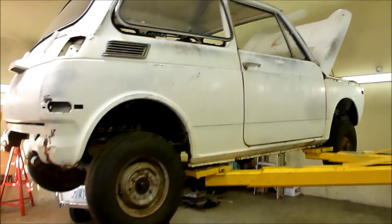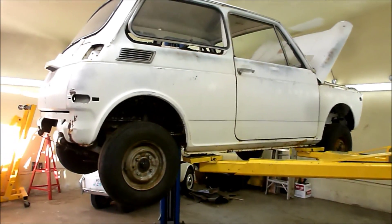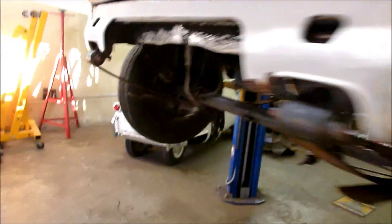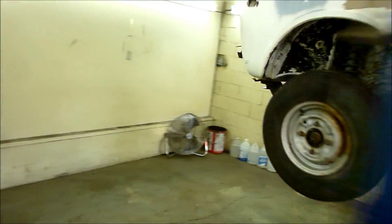It's been some time since I've done an update on my Honda 600 with a motorcycle engine. You can see we've got it up here on a rack, and I'm happy to say all the brakes are done. If you look up in there, we've rebuilt the wheel cylinders, turned the drums, got the e-brake working, and replaced the brake lines where needed.